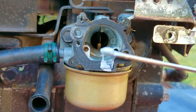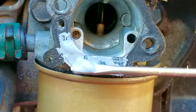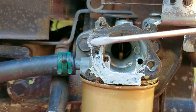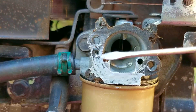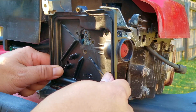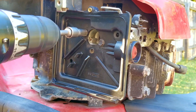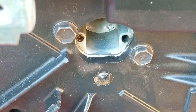After taking the base off again I'm going to put a thin layer of gasket maker on the area where the air passage seals against the gasket. Don't forget to work it around the opening of the hole and try not to get any of it near the hole itself. I'll let it set up for a bit then reinstall the base. I didn't wait too long — just let it tack up a bit. Be careful not to let it cure before replacing the base, and when you reinstall it, try not to disturb the gasket maker.